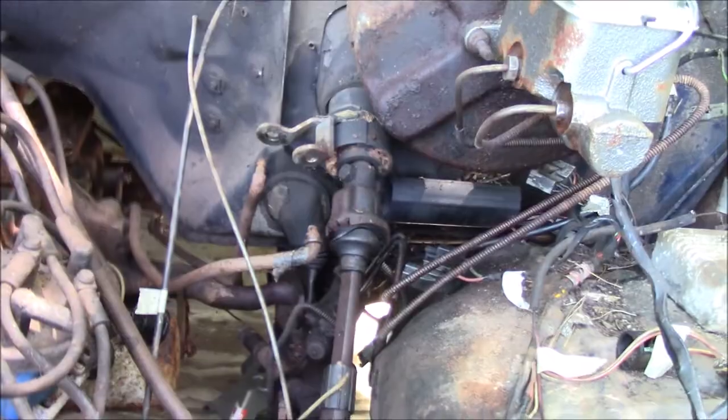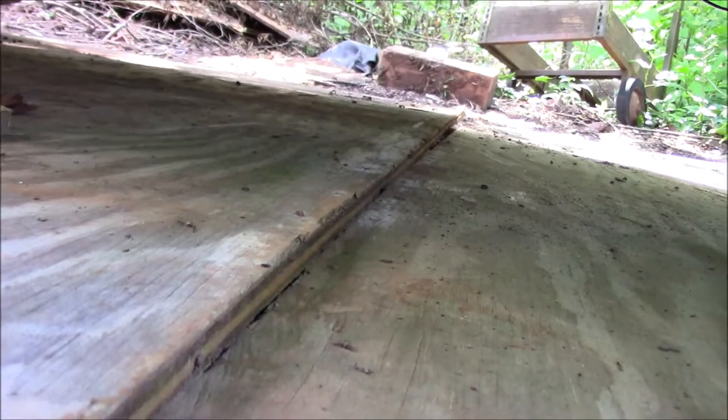But yeah, what I think we're gonna do is go ahead and try to yank this motor out. We've been working on it some today already. We got linkage disconnected from the column. The clutch is still in there, but we did get the exhaust manifold taken loose. Gonna work on getting the tie wire that's holding it up cut, get that exhaust out from underneath the truck. What we really spent a majority of the morning doing was getting all this wood and these jack stands under here. Getting it up off the ground took a majority of the morning, so we haven't really got to do a whole lot of actual work today. So yeah, hopefully we can get this exhaust out pretty quick. It looks like somebody put a cherry bomb in here.